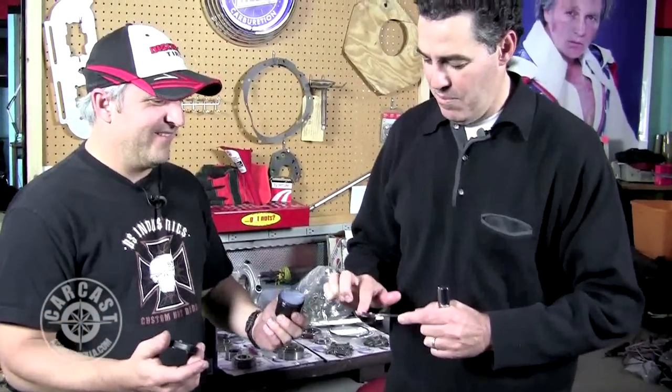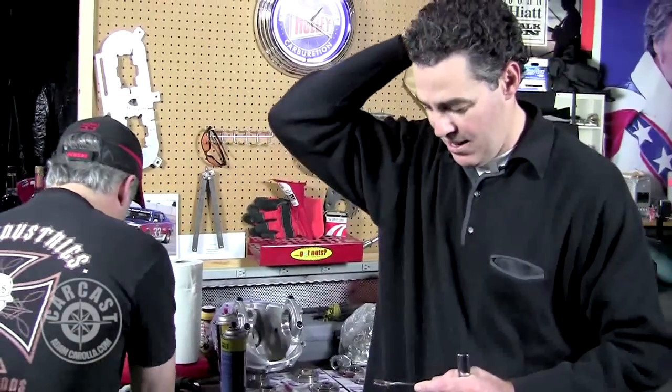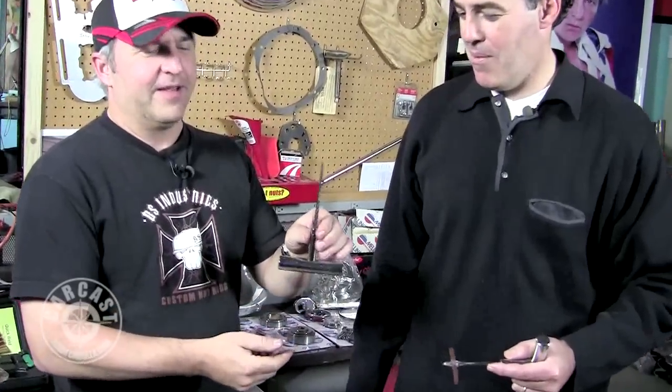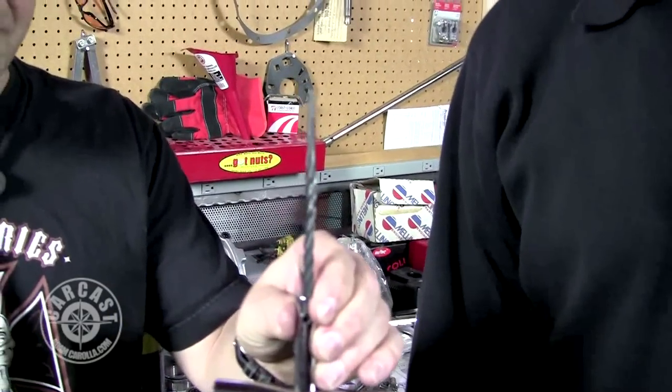Yeah. Right. So we'll lube this thing up, and again, if you have any extra, you just weave it right into the hair. Before we do that, we got to get the reamer in the hole. Get the reamer. In the hole. That was my nickname in junior college. The reamer. The chicks dig it. Yeah. This is basically just to clean out that hole. Clean out the small hole that may have steel belts in there.